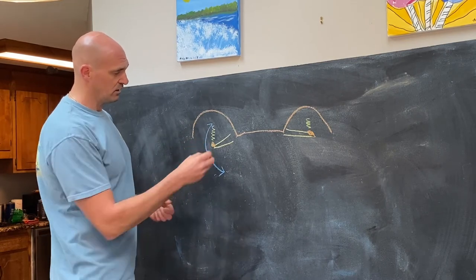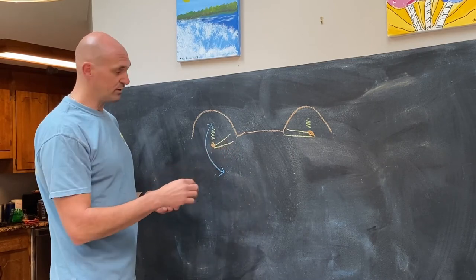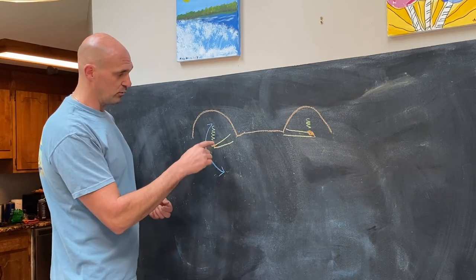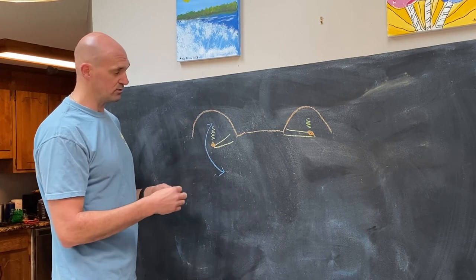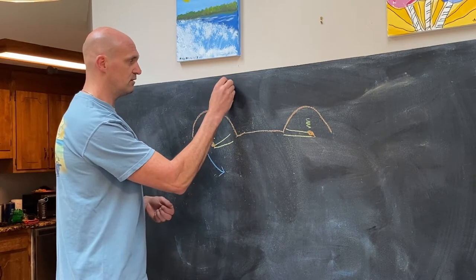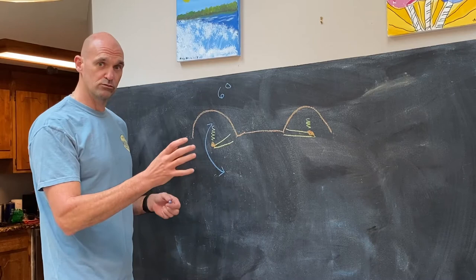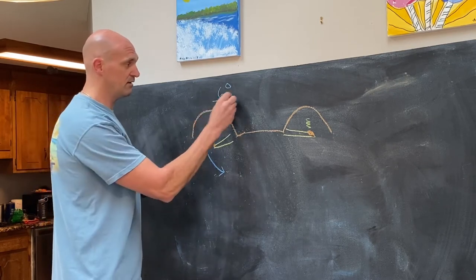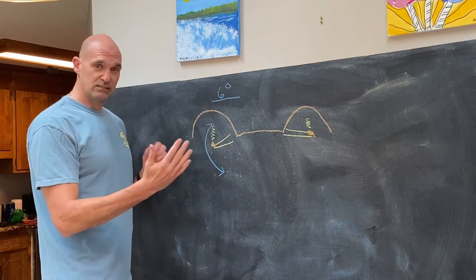When you lift the vehicle, these arms — stock — are supposed to be in a fairly parallel form. What that does is it keeps the axle centered within the wheel well and keeps the caster correct so that your vehicle turns the way it's supposed to. On a stock vehicle, six degrees of caster is what you're looking for, and all of your adjustments with control arms and correction brackets attempt to maintain that — especially in the front end, because that affects how the vehicle steers.